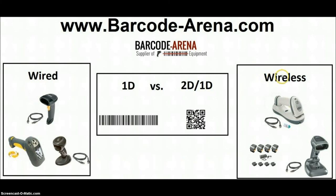Moving on to wireless scanners — these are battery powered and come with a cradle to charge. Here's the most basic wireless scanner and its cradle, which charges via USB plugged into your computer. The cradle also has a wireless radio: when you scan, it sends the barcode from the scanner to the cradle, which then inputs the scan to the computer through USB. You can also direct-pair the scanner to a phone or tablet via Bluetooth instead of using the cradle for communication, using the cradle just as a charger.